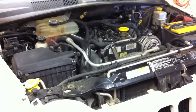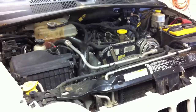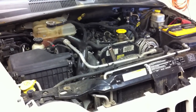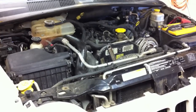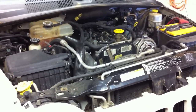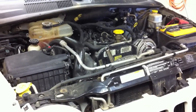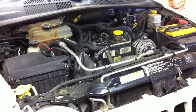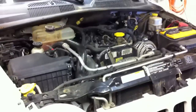On this vehicle, at 100,000 miles the timing belt is due for a change. If you fail to change it and it slips or breaks, it can damage the rockers on the engine. When the rockers are damaged they need to be replaced — they cost about $47 each and there are 16 of them. A belt is pretty cheap compared to almost $800 just in rockers plus all the additional labor.